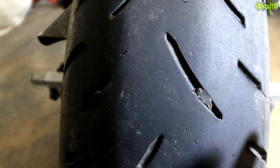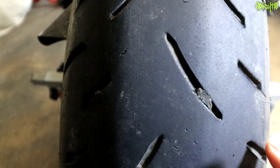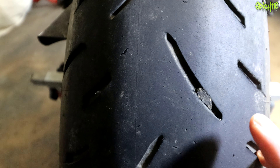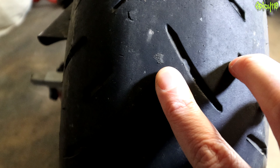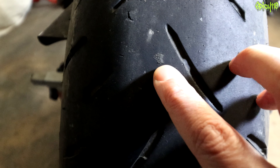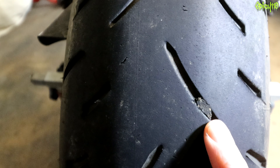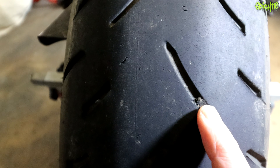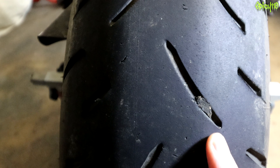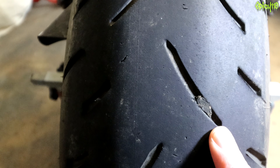I am at no point suggesting you should go against the manufacturer's recommendations, and I'm not suggesting you should do anything I've said in this video — what I do is my thing, your risks are your risks, and I take no responsibility for what you do. But I did want to answer the question for myself: how long do these rope plugs last? I can say 6,800 miles of the seven and a half thousand miles this tire has done — that plug has been there and never caused me a problem. I do ride this bike quick, and the other plug, while not ideally placed, is still in an area I'd be happy to repair, and it's done nearly 5,000 miles with no change and no air loss.